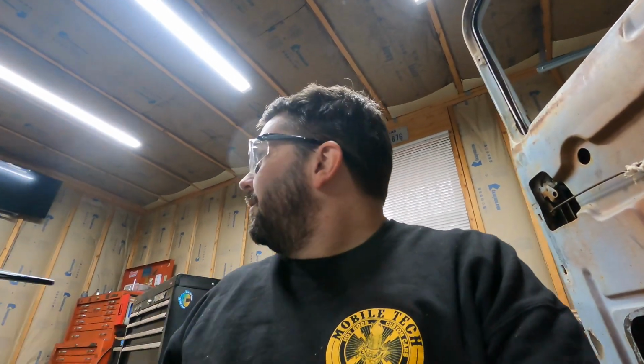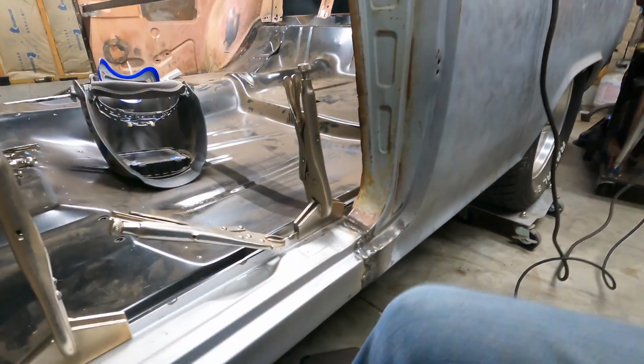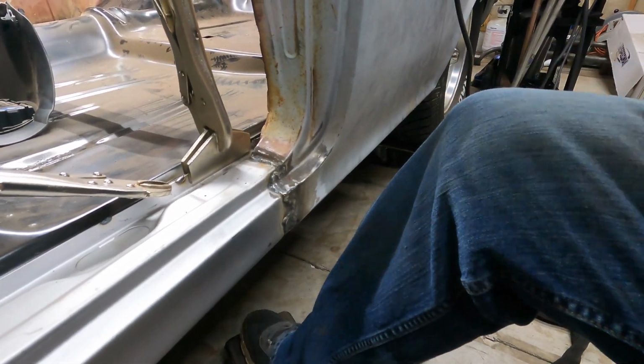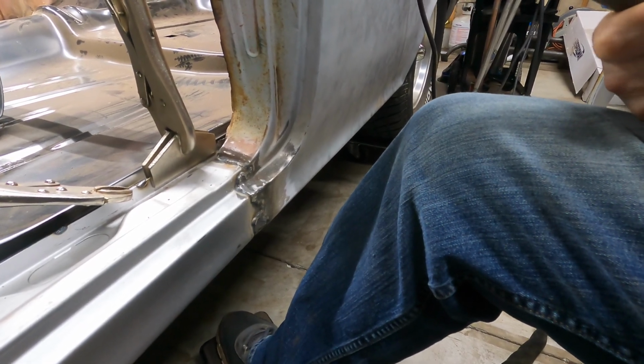And then once I've got the hole completely filled up, what I do is just rest the tungsten on that spot, and I've got my machine set to 100 amps, which is really high. Welding this sheet metal, you can do it somewhere between 45 and 60 amps depending, and you'd be just fine leaving it there. And that's what I do with the pedal. I've got it just start to get on it just a little bit, and I've got the machine turned off right now. But you can go all the way down. That's 100 amps. But I'm usually just touching just enough to maintain the arc, and I'm hovering in the 50 to 60 amp range. And then anyway, when I get the hole filled in, I'll hold this right on the center of it and ramp it up to 100 amps for a moment.